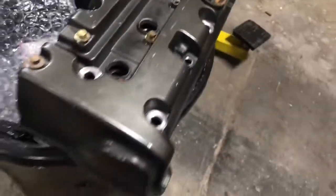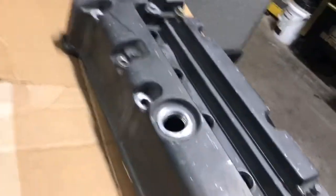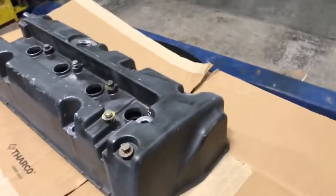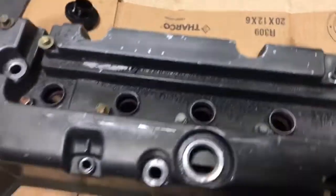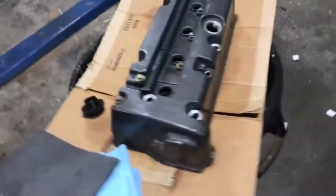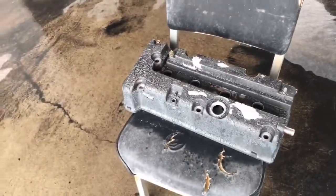It's a decent deal because I keep messing it up — this time it's gonna be fixed for once. Here's the valve cover; I need to degrease it and scuff it, but right now it's chipped up and real ugly. The surface is scuffed, I'm gonna clean it off again and check for any spots I missed. I used carb cleaner and brake cleaner and it's actually eating away the paint, so I think I'm just gonna strip it completely since I'm already halfway there.